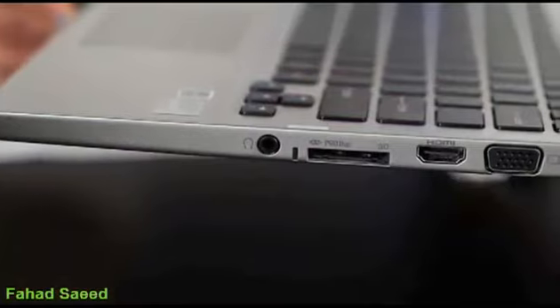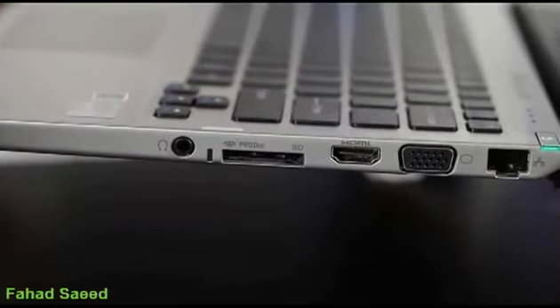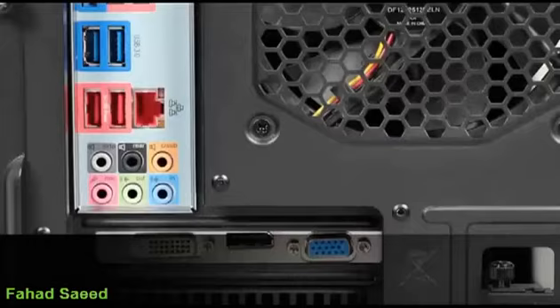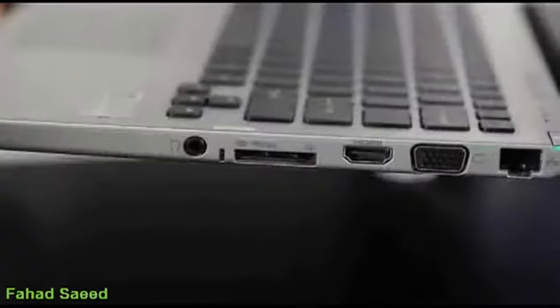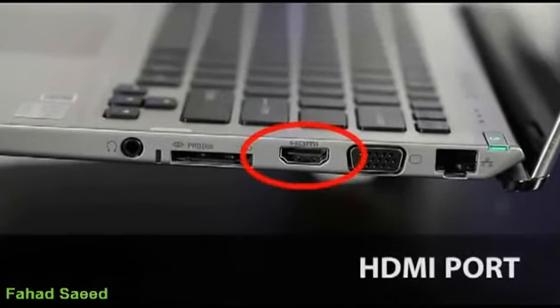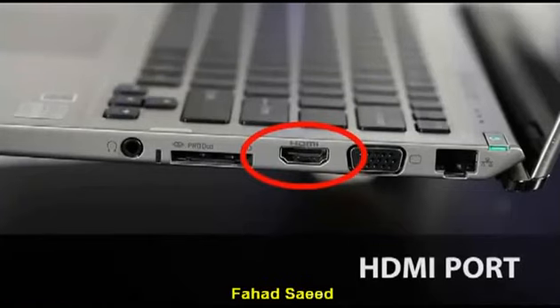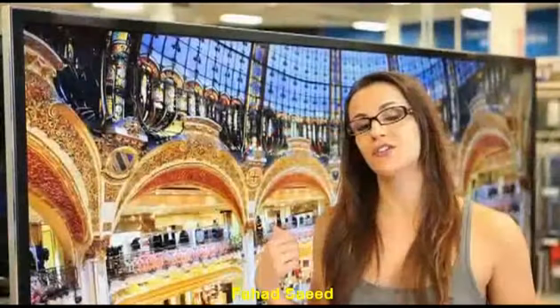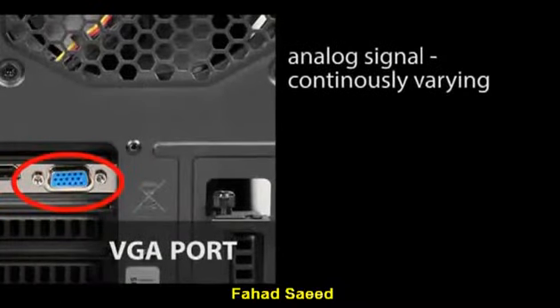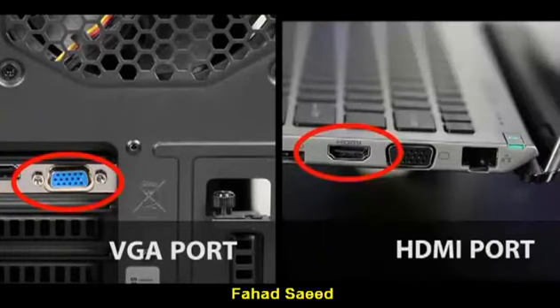Let's take a look at this particular laptop, which has a VGA port — usually 15 pins and three rows of five — and is how your laptop connects to a docking station. Some computers have VGA ports as well. Then on this particular model there's an HDMI port that looks like a USB port but longer and thinner, available in laptops since 2008, and it's really good for HD connections, especially if you're gaming or watching movies online. VGA provides an analog signal, so it's not as high quality as an HDMI cable that sends a high-def signal.